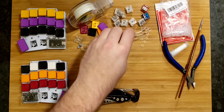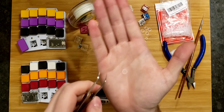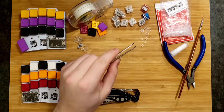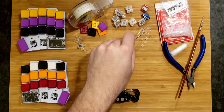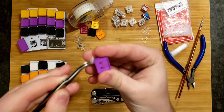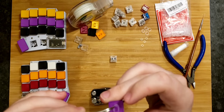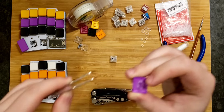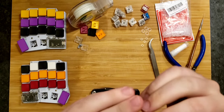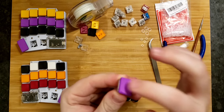O-rings are the thing we usually use with MX-style switches — this is already a popular technique. You can get these on Amazon; I've got a little baggie I got on Amazon, and I'll put a link in the description. They're really easy to find and pretty easy to apply. You just take a cap, use your tweezers or fingers, put it on the inside of the stems, and then put that on your switch.